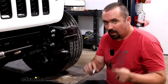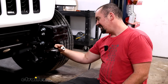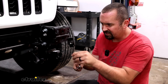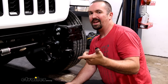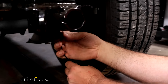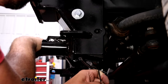With all that hardware in place, our last piece is the nut plate — it's got a little handle and it feeds up from the bottom. We'll have a bolt with a split washer and a flat washer going into the lower hole. It can get tricky: feed this up and try to thread it through. You can bend the tab slightly; just be careful not to break it off at the weld. Use this large opening to guide it — if you hold it in place and try to thread it blind you'll get frustrated. I got fairly lucky here with just a few bends to get it aligned, but it's still pretty tricky and you may need to move the base plate around to align the hole.